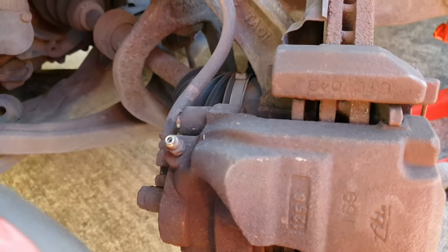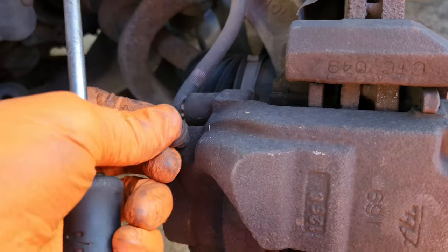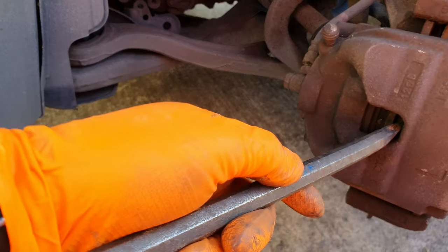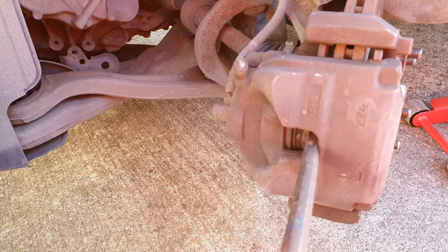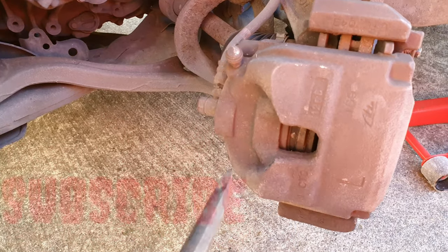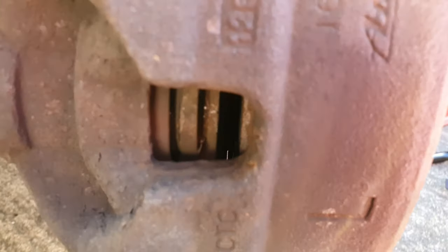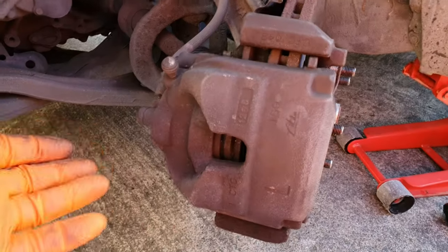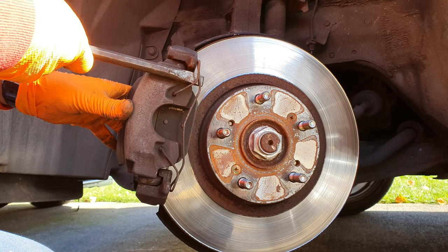Some people use the bleed valve method, but I do it this way and it works for me. You're probably better off getting something really hard like a chisel rather than a screwdriver, which flexes. That's fully reset there — you don't need any brake reset tools. It's easy. Now just release it over those little clips here and pull everything off together.